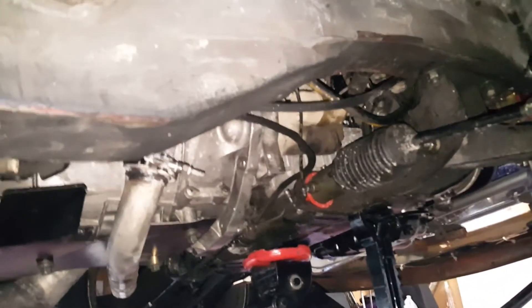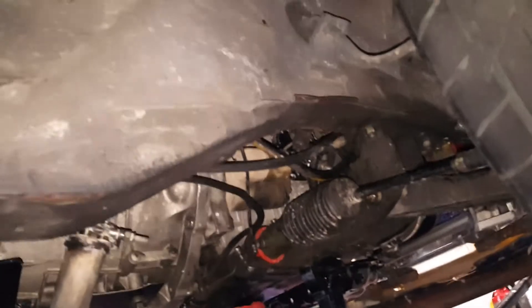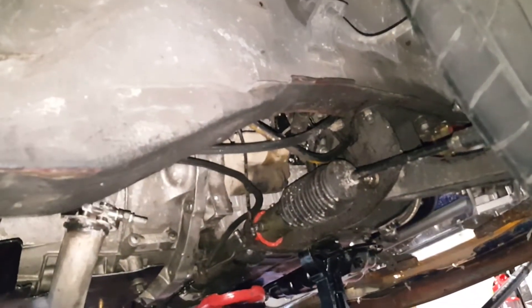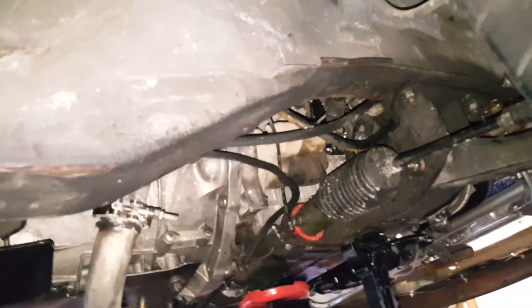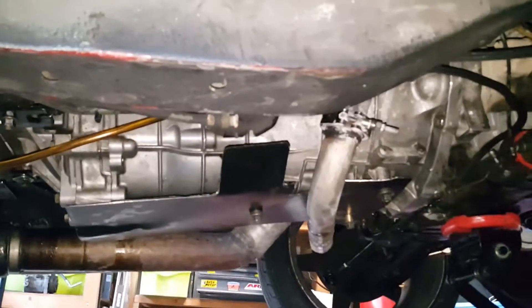The reason the car is jacked up is because I changed the starter — it was giving me trouble. To get the starter out I had to remove the whole passenger side manifold and motor mount. When I did that, the pipe bottomed out. The v-band was fine but it cracked the pipe up top, so I had to weld that all back.